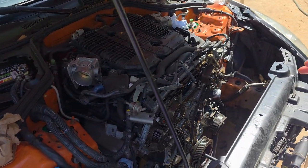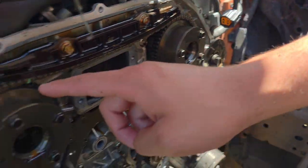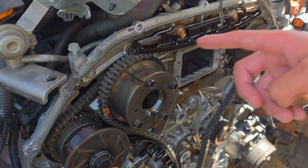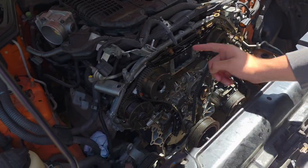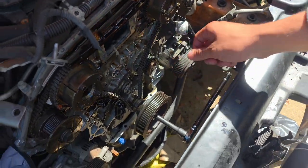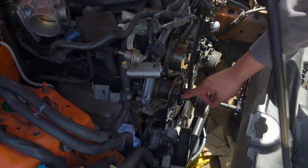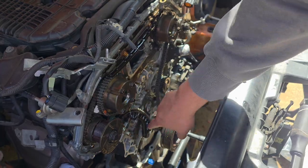And make sure it's top dead center. Mark it. I marked it over here, and I spun the engine once, and it didn't line up. But I think it's 27 rotations that the engine has to do for the marks to realign. I just learned that, so right now I'm just gonna mark it again on the dots. We'll show you what that mark looks like too. We're gonna take this off, take the gallery gaskets off, put this back up. The new tensioner, I have it inside. We'll show you the parts whenever we're doing that, and just bear with us.